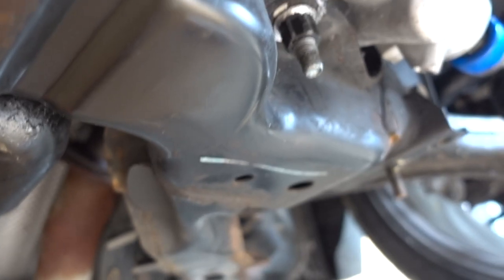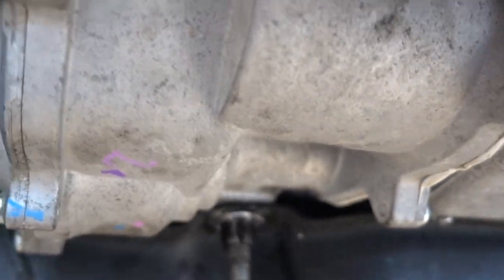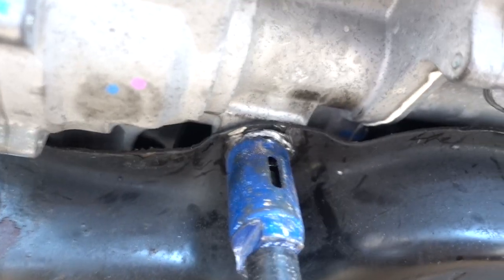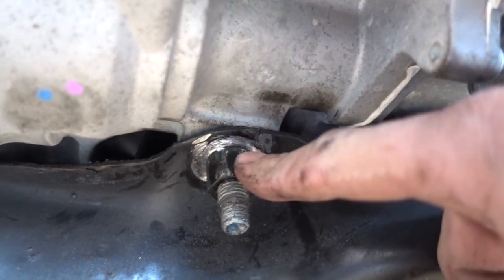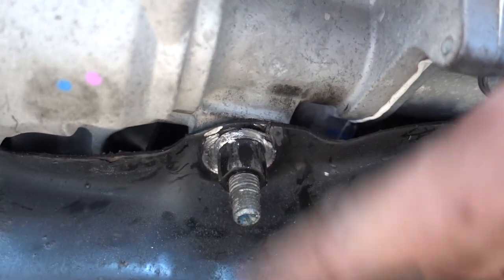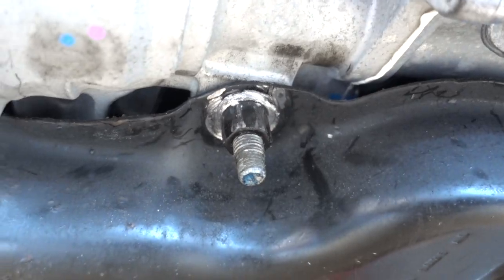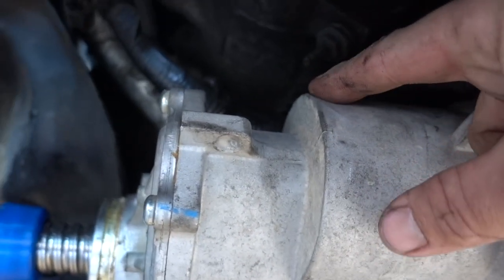Getting these bolts off right here is tricky — there are three 18-millimeter bolts that bolt in the rack and it's really difficult to get those out. They bolt in from the top side, but you can't even get a hand in there. You can kind of cheat your way around that if you take a drill and a three-quarter hole saw and drill around this — it'll get rid of the welds because it's a nut that's just welded onto the K-member. If you drill all that out, you're going to have to repaint it. You might even want to replace the nut and bolt and give yourself a decent washer. Ford actually recommends replacing these bolts because they're stretch bolts that are really hard to loosen up. It'll take you forever if you try to get above this with the motor still in.